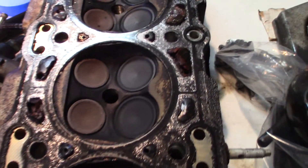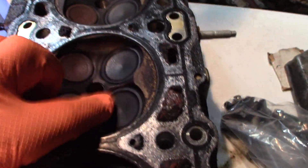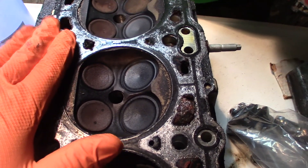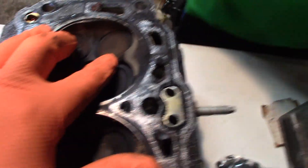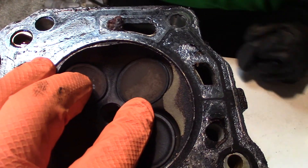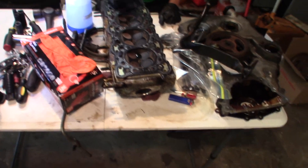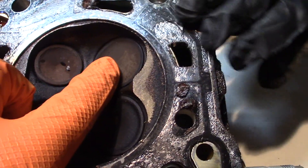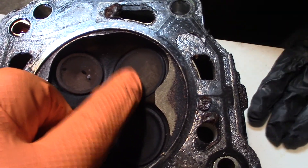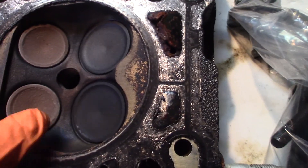On the head, everything looked like it was burning pretty good, but right here on number 2 these two exhaust valves are a little darker than the rest. That's probably a result of the low compression and not burning as well. And then down here on this end this exhaust valve looks like it's a little bit rusty compared to the rest. But I think it's all saveable. This exhaust valve being a little more beat up would explain why this one had a little bit lower compression than the other two — it was in the 170 range, and then the other two were like 180 and 185.